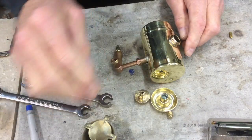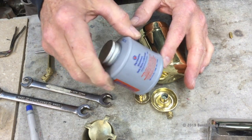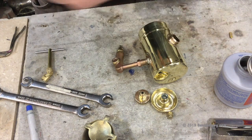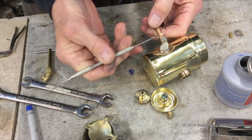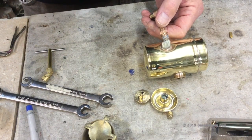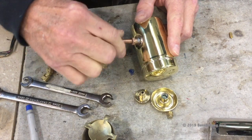I'm going to stop and show you something else. This is Permatex aluminum anti-seize lubricant. There are all kinds of flavors of this same stuff out there. It's designed to put on threads, which is what I'm going to do here. It doesn't actually help so much to seal, but it gives a little lubrication and makes it much easier in the future to remove things. It's designed to operate at really high temperatures — something like 1,600 degrees Fahrenheit. I just like to use it; it makes all this stuff so much easier.